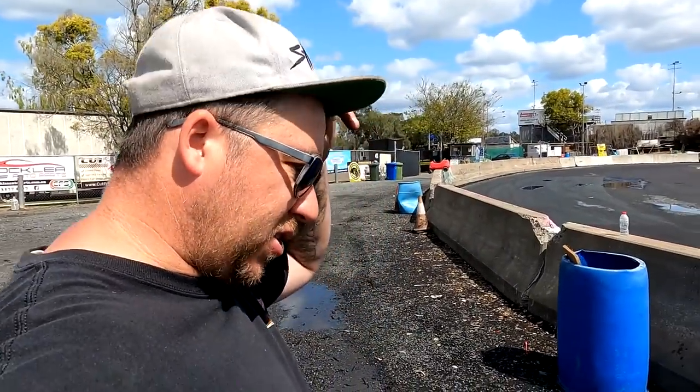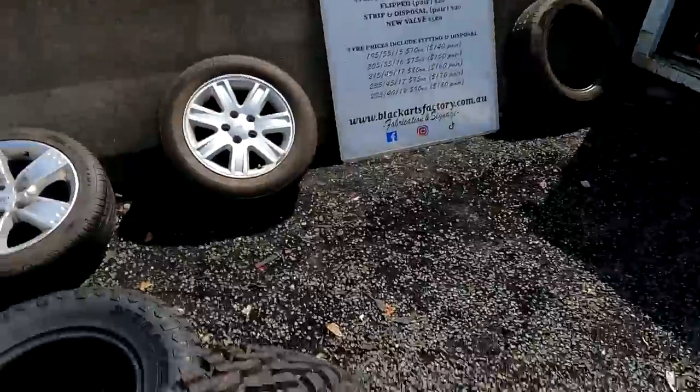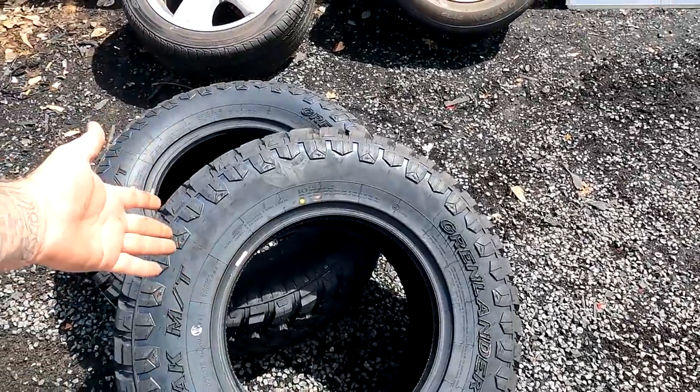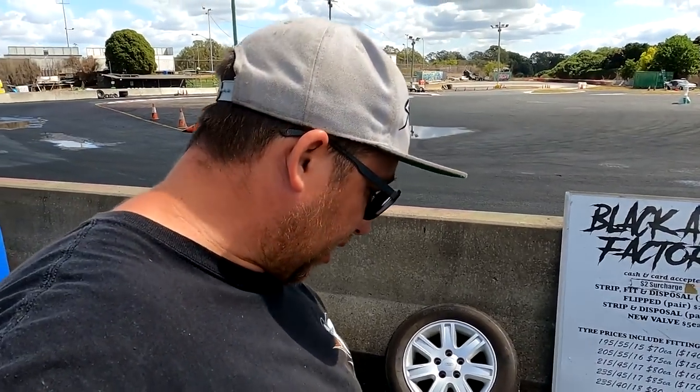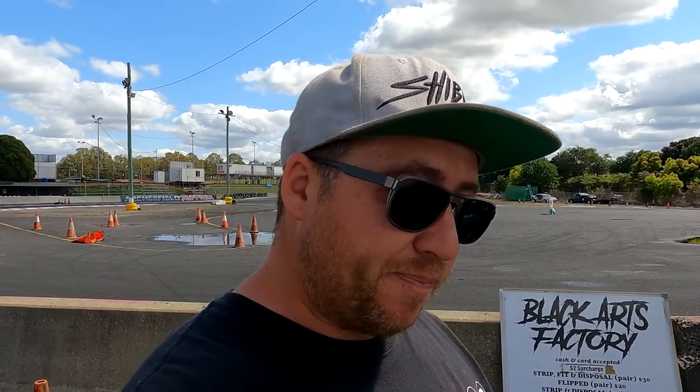Okay, scratch that. The tires I got before, for some reason they accidentally sold me 15s instead of 16s, so I got these ones for the front now. Essentially the same size, so we'll give it a whirl. They're just slightly smaller than a 31, 35s on the rear. I didn't want to go too big on the front because the problem I had with the old Barraptor is the front tires jamming up on stuff. So I don't want to make the same mistake this time. I'll chuck these on. I'll have to do some cutting, some clearancing to make these work. But when they do, I think they'll obviously work better than the 33s we did.